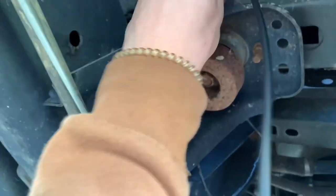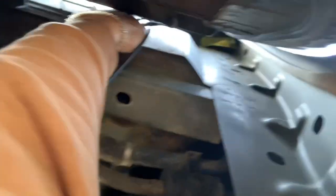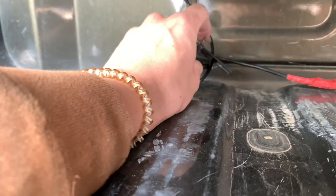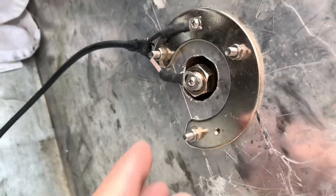See this is what I'm talking about — the previous owner's mess. Take the cable, run it up over the cab mount, pull the slack out. Pull this plastic piece off, go back under the truck — maybe pull the plastic part off before you get under the truck. Find the bed hole, reach up in there, and just run the wire through. I got a hole drilled for the bed lights — run your wire through the hole, back through the toolbox. Take some tape, wrap it around it, stick it back in there to keep the wires from going back in the hole. I take a zip tie and just zip tie them all together so when it pulls, the zip tie stops it.